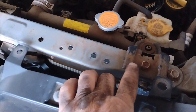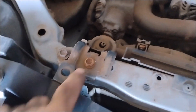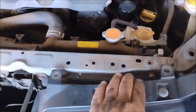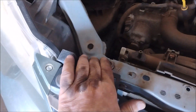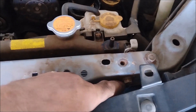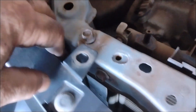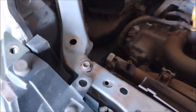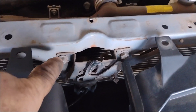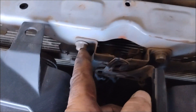These are the two radiator stays here and here, and I'm going to remove them. Now I have this entire radiator top support and I'm going to remove it — it has two bolts on each side, one facing forward and one facing up, same on both sides. I also disconnect the crossmember from the hood latch stay using these two bolts. By the way, all the bolts I'm removing off the crossmember are 12 millimeter heads.